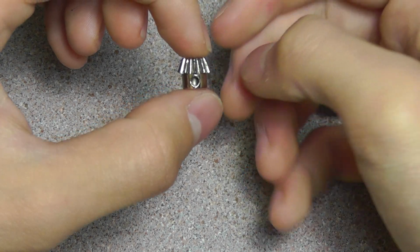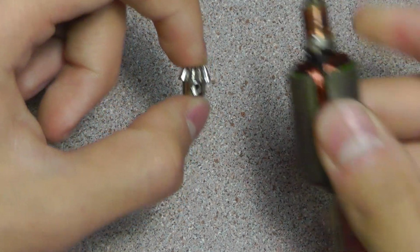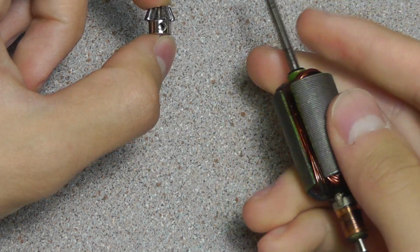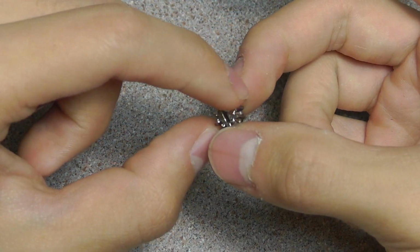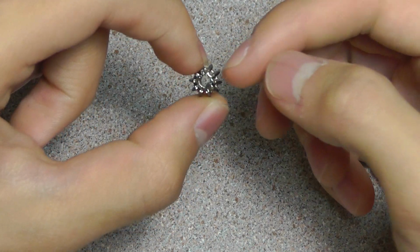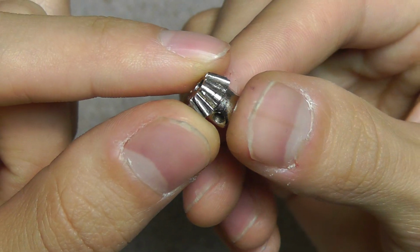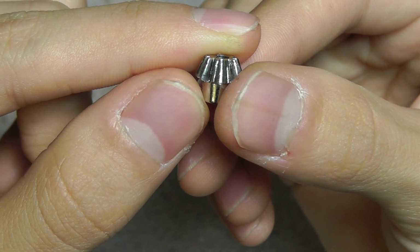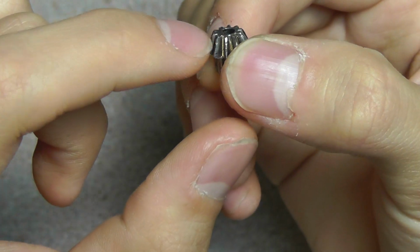Because after like a couple hundred rounds, when I first got this pinion, I tested it out in this Chromoly Frankentorque motor, which ironically this armature died on me, so I gotta throw that out sometime. But after the first couple hundred rounds, I pulled the motor out, just curious to see how the coating was going along, because I heard that it was starting to flake, and sure enough, I don't know if you can see it. It's kind of hard to see on camera, but it was starting to flake to the point where I could just take my finger and flick it off the sides.